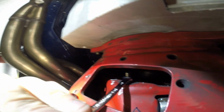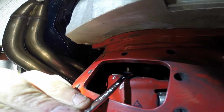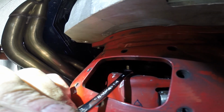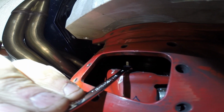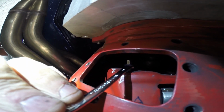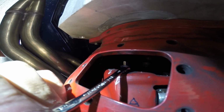Okay, because I really can't get an Allen wrench in here, so I use a little bit to go into the adjuster of the eye bolt adjuster, and then I just use a quarter inch wrench to turn that bit, and so I'll turn it three flats, which will give me a half a turn.